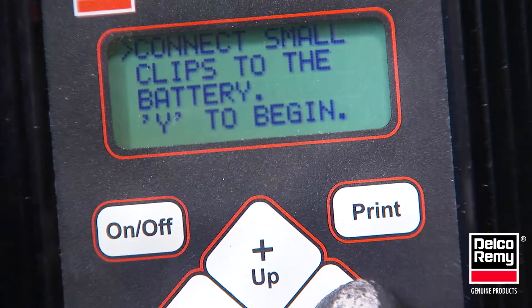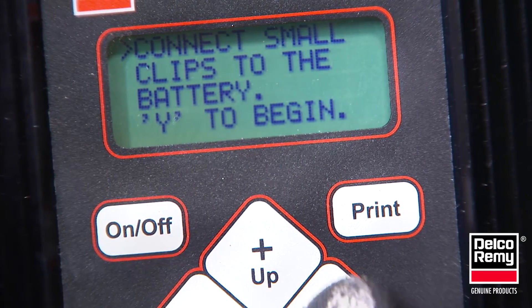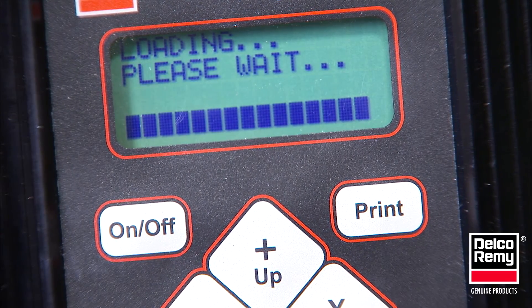But if you are using a remote sense, then you should remove the jumper. If your alternator is using a remote sense, you will need to keep these tips in mind when performing charging system tests. Remote sense will elevate the system voltage to overcome the cable voltage drop and regulate at the point of termination.